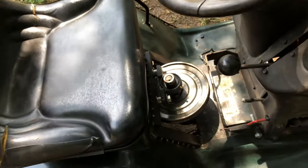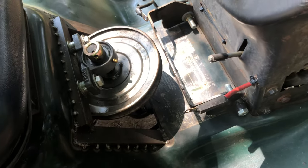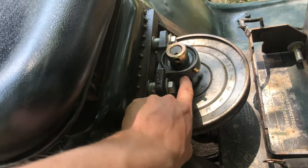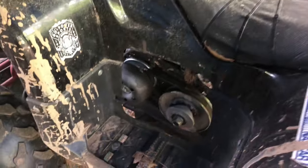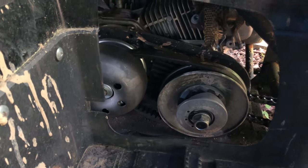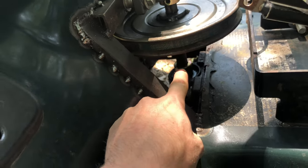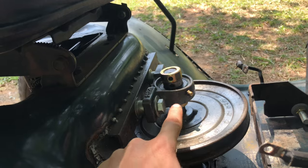In the midsection, I have my battery mount welded in place — though I still haven't gotten a battery. This is a three-quarter-inch jackshaft with angle iron welded around it and pillow blocks installed. That jackshaft actually used to be in a little Chinese four-wheeler before I put a torque converter in it. The other pillow block and pulley are locked in position, and the shaft runs up to an 8-inch pulley.